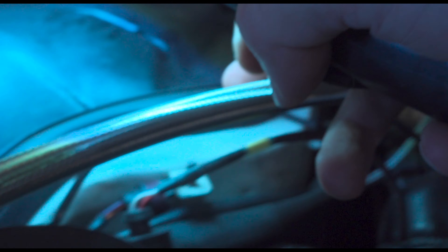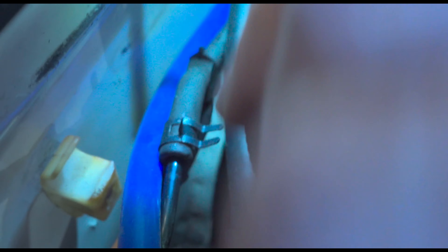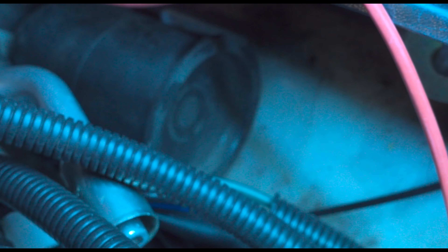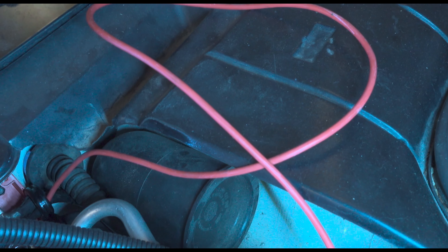That's two out of four done. The next one is the center connection — a 1/8 inch NPT 90-degree to 1/8 inch connector going straight through the top of the intake. If we follow it, you can see it's routed over the top of the fuel line and then goes all the way into the vacuum hard line that came stock with the 944. It circles around behind the engine and then goes into this Y-connection right here. This Y-connection splits into two separate places.